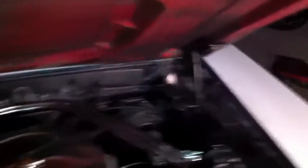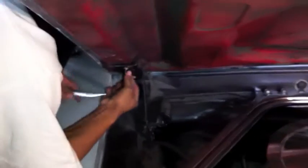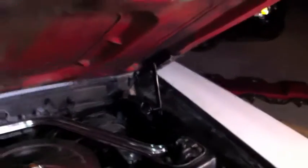We're gonna put the hood back on and then get the hood aligned and mark the point where we're going to drill the holes for the pins. We were able to get them down an eighth of an inch, realign them, get shims in on the right-hand side to readjust, and we have a good hood alignment. Boom — that is a good alignment on the hood. She is tucked down nice and neat.